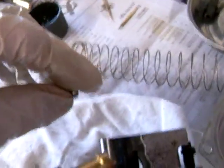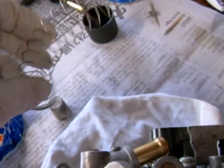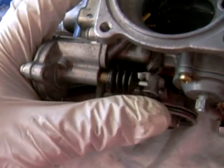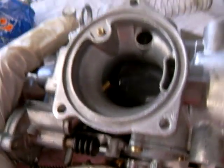For your covers that you put in, don't forget to put your springs on — it doesn't really matter which way it goes. Just don't mix up the springs because I don't know if they have different tensions. Getting this carburetor cleaned with gasoline and carburetor cleaner is a pretty decent way to clean it, with a toothbrush and wherever you can get into these small holes with a toothpick or a Q-tip.